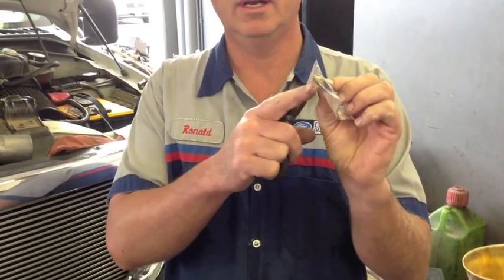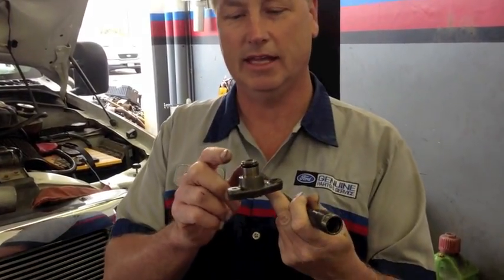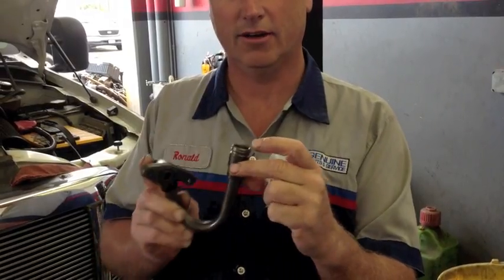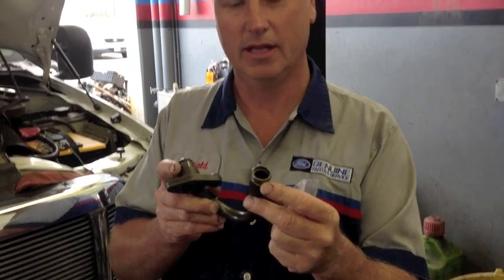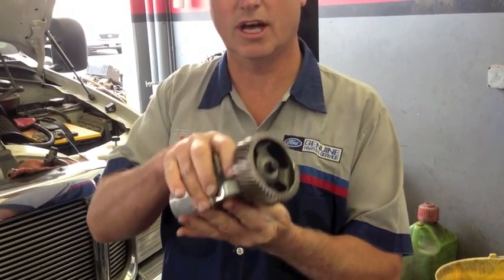A few things to go over here that may seem obvious but I've seen happen a couple of times. When you get new seals in the package, the yellow one is for the base on the engine block underneath the pump — make sure that goes underneath the pump. I've seen people put it up top where it doesn't belong, and it'll burn and fry. Make sure the yellow one goes on the base and that you use the proper black one up top. Also inspect inside here because I've seen this O-ring fail and it will cause a high-pressure leak — it may just cause lack of power or a check light. Last thing: most pumps aren't coming with a plug in the bottom, but some do. I've seen on forums where people put the pump on and have absolutely no pressure because they didn't pull the plug out of the bottom. Inspect it and make sure there's not one there before you assemble it.